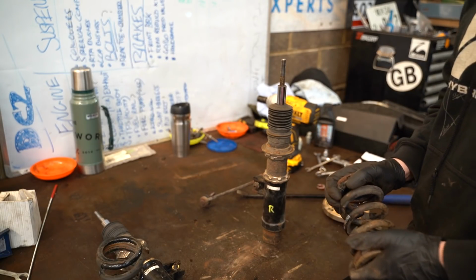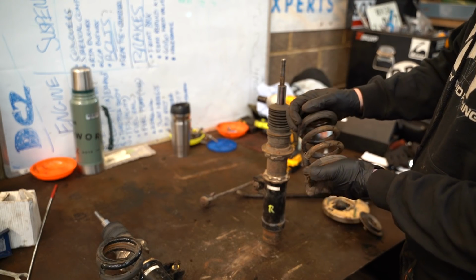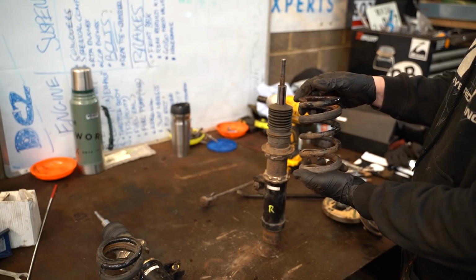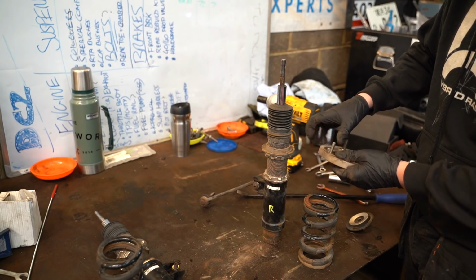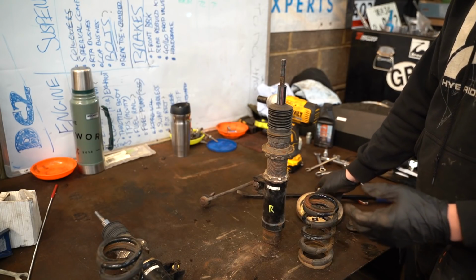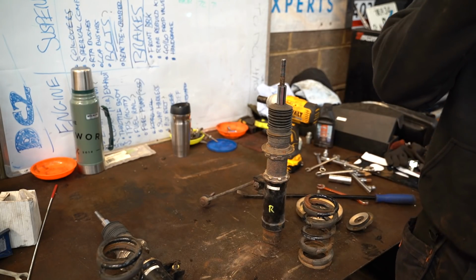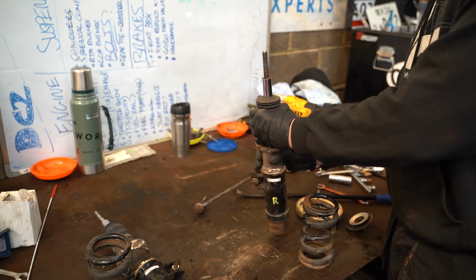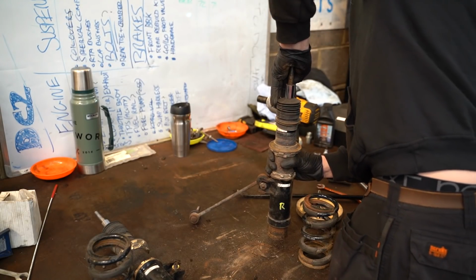So the theory here, chaps, if you're not following entirely, is the twanging noise could have been from these springs either not being allowed to rotate, which we found that the bottom was pretty stuck, and then twanging back into shape when they transition to the other side of the car when the weight moves. Or the same theory, but could be coming from one of these top mount bearings not allowing the rotation. Because these are McPherson struts, so the entire shock body turns with the steering of the car, unlike the Integra. The MR2 is a McPherson as well, so that all happens there. But yeah, the DC2 stands alone with that because, you know, double wishbone front suspension, the stuff of gods, and unfortunately the MR2 nor the M3 feature this. How's this damper feel? Oh yeah.